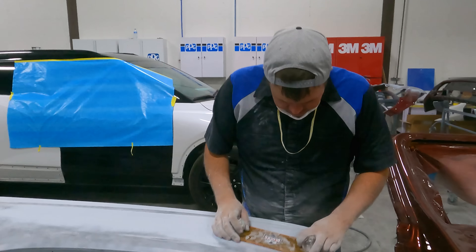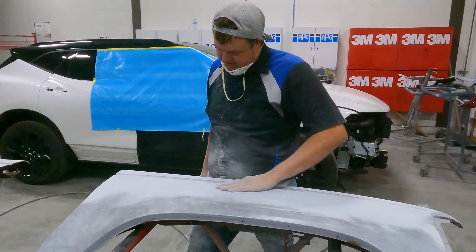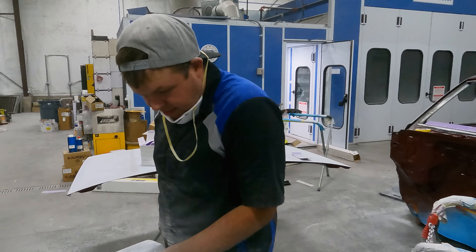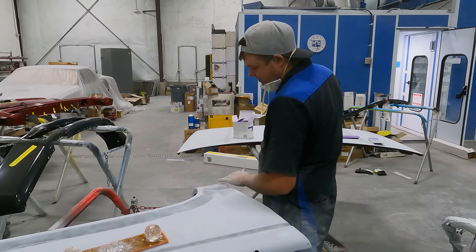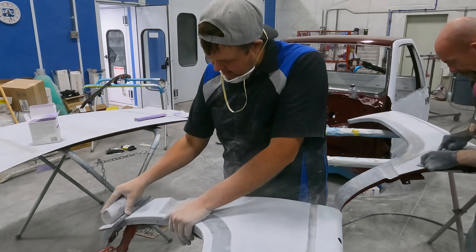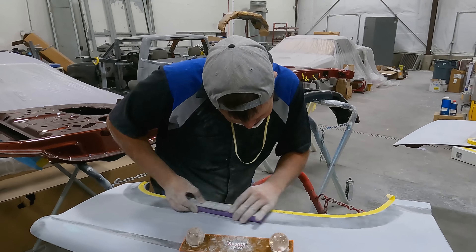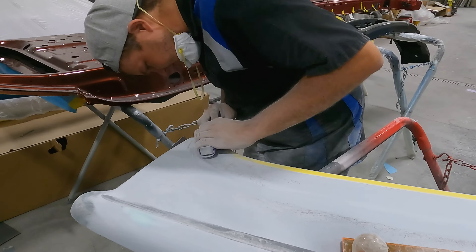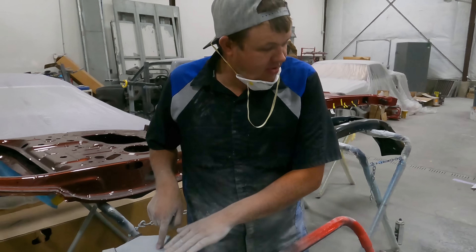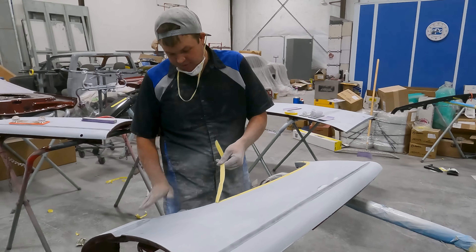No pressure — let your sandpaper do the work. It's blocking out nice. It's not going to need a full reprime, just a little spot mud work. You just keep on sanding and the imperfections just fall off the panel. I'm getting close to having this blocked — I've got one bad spot down here I need to work out. Block until you can't block anymore, then if you've got material, cut it down. I've got my body line taped and a body line block for GM, blocked to the tape, getting this all smoothed in. This fender is awesome compared to the other one.